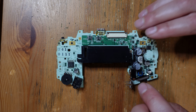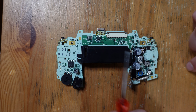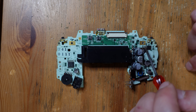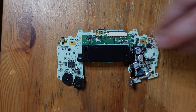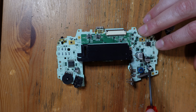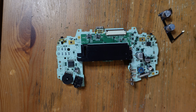I'm going to start by removing the speaker, and then we're going to install the D-Hum and D-Hiss kit. This will help filter the sound and make it sound a lot cleaner, and I believe this is true regardless of whether you add an amplifier or not. Where we're going to solder is to three points: these three capacitors right here, the ground on the battery terminal, and the positive lead of this electrolytic capacitor. I do find it's helpful to pre-tin the electrolytic capacitor point and the battery ground just to make it easier to connect — it's not as necessary for the three ceramic capacitors.